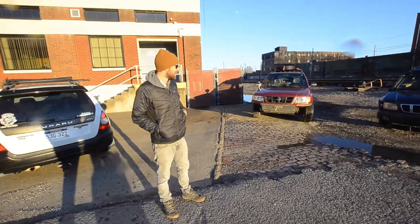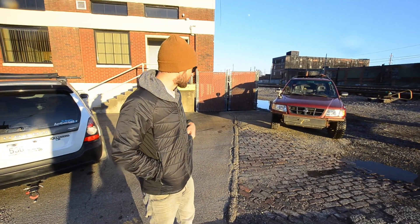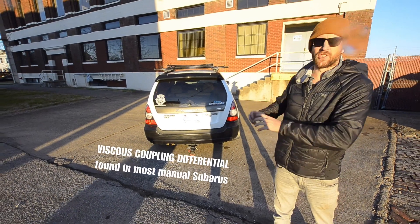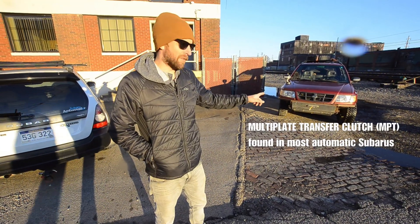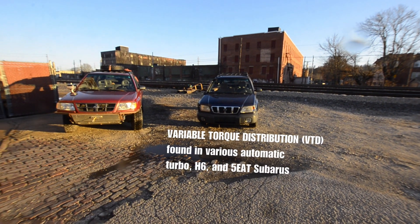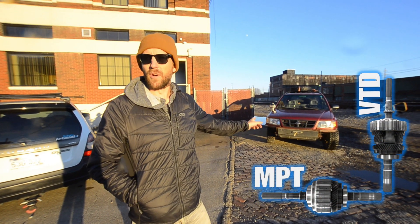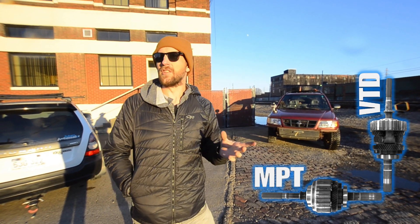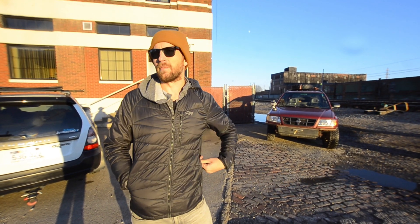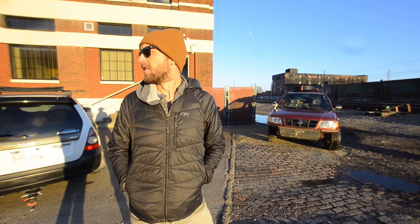What we're trying to find out is which of the center couplings, sometimes called the center differential, can transfer the most torque to the rear wheels. Manuals are a true torque split because there's actually a differential inside the center. Automatic transmissions are front-biased, with optional drive to the rear. Bluebaroo has the VTD center, which does have differential gears in it as well. The difference is the MPT in there is much smaller than the one in the unit that's only an MPT, because it has to fit in the same physical space. That made me concerned that the MPT might not be able to transfer as much torque. The only way to really know is to test it.